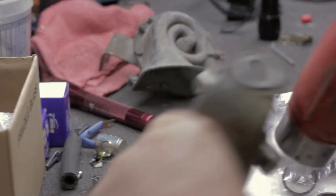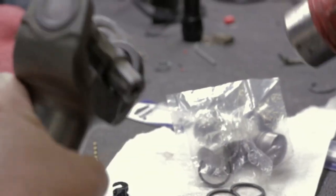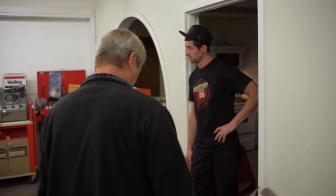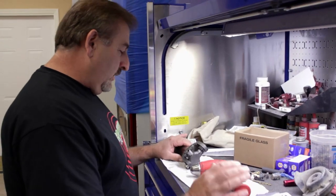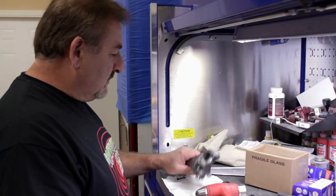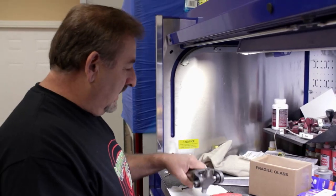So we had a successful initial start for the '71 Charger. We ran it through the gears. We did have one minor problem, which was Dumb and Dumber didn't put the clips on the U-joint caps, so it spit it out when I went to put it in park. But the way this thing looked, I remember when you two beat this thing to death, like some kind of WWE death grudge match, fight to the end. You beat this thing within an inch of its life.